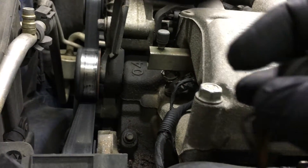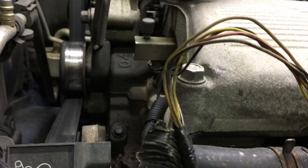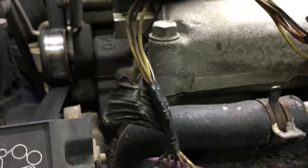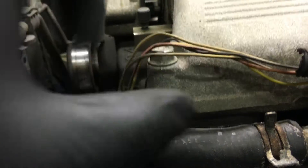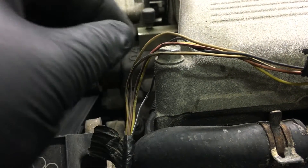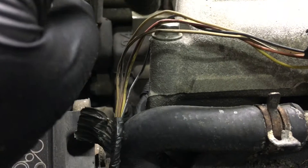It is connected, but just barely. So I'm going to cut this section out, because that's a bad wire internally. It's probably from being plugged and unplugged and being around this bolt over time — the engine rocking back and forth has just sort of put pressure on that, the corner of the bolt.